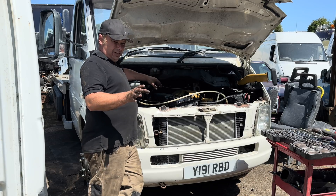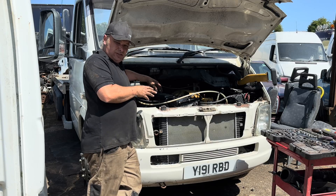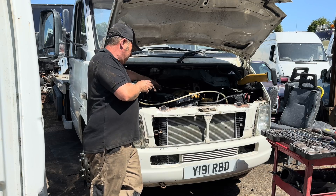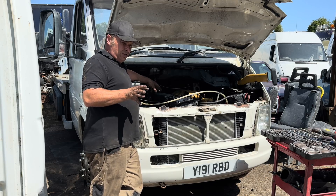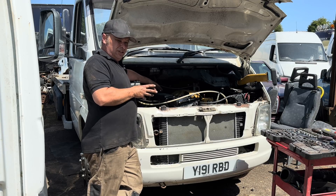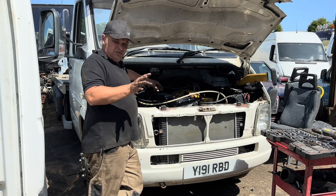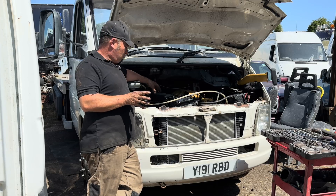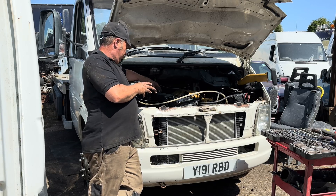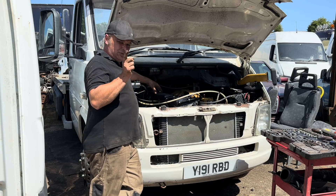Lots of people put the OM606s in, which is a very good engine. I like 606s, but I do like a 603. Same sort of thing, but 12 valves instead of 24. Now all the British versions were non-turbocharged and were a bit made of fromage on the inside. So if you boost to death your standard British one, the conrods bend, pistons melt, there's no piston oilers, it all goes a bit horribly wrong. So what you need is the European version that came with a turbocharger. This one went and found two of the European versions because it's always good to have backup.